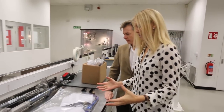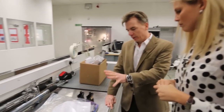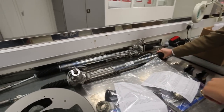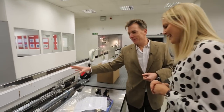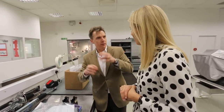There's a shopping list of things laid out here. If you imagine how much stuff there is in a road car, all of that is replicated in a racing car. On this table we've got all the components to make a front upright assembly — that's where the wheels are attached to the suspension — so you can have the brakes in there, the wheel bearings, the hub and all of that. That all has to be built by hand. Behind it there's a steering rack — fundamentally the same as you'd see in your road car — powered by high-pressure hydraulics, because if you try to turn the wheel without powered steering, you need biceps like a Russian gymnast. All these sub-assemblies are put together here before fitting them to the car, rather than building them next to the car.